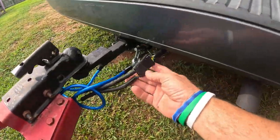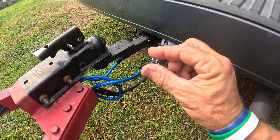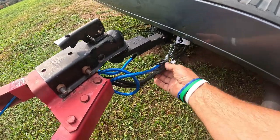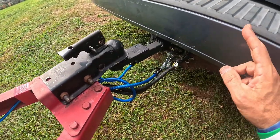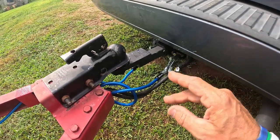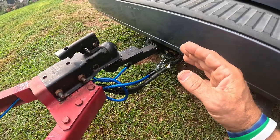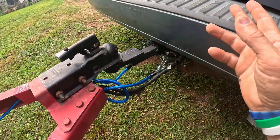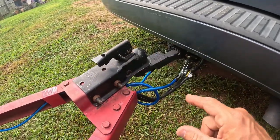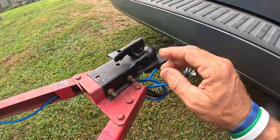One thing I found out with ordering this kit is I needed to get three relays and two fuses — two 20-amp fuses. I'll leave links to all the stuff to wire one of these vans up. The Mercury Monterey and the Ford Freestar van, you know, between 2004 and I think maybe 2009 — they only made this van for about five years. I'll leave a link below where you can pick up all this, but let me show you where the relays are for the trailer lights and the fuse.